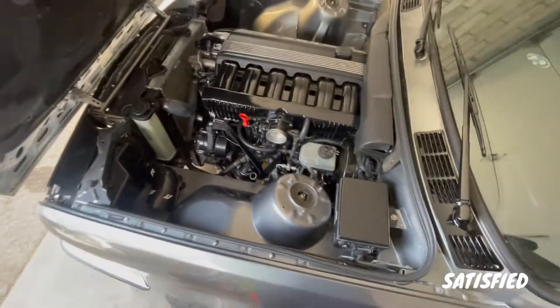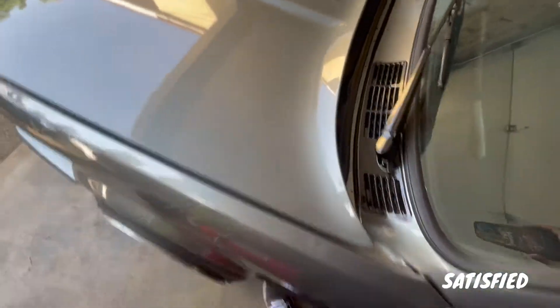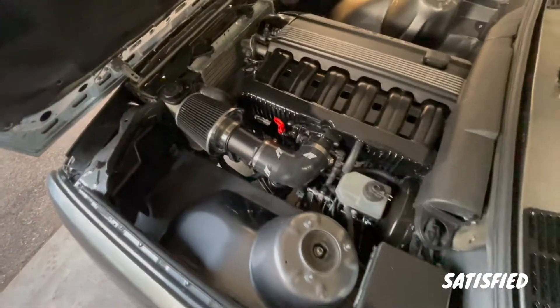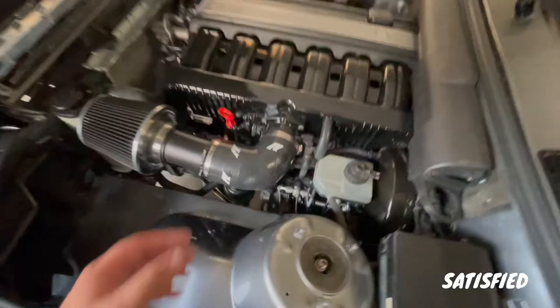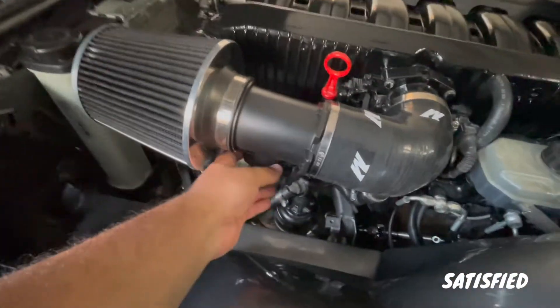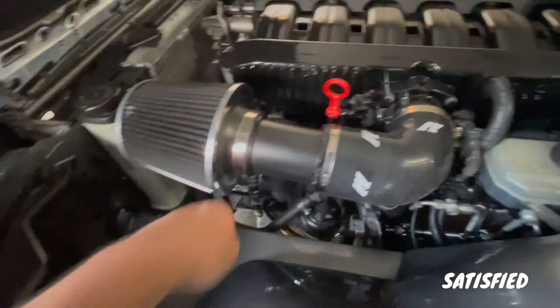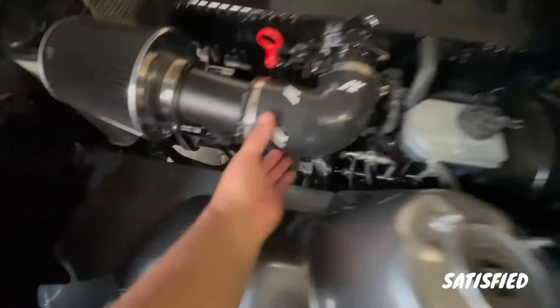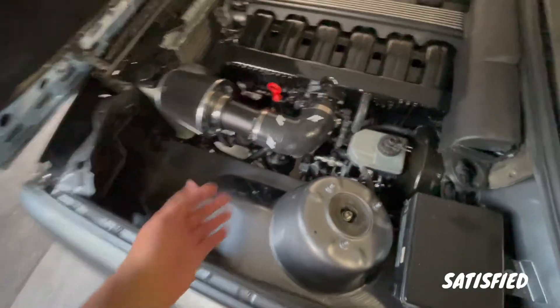Do what everybody does — close the hood, wait a couple seconds, and then magically everything just goes back into place. This fit perfectly fine. The silicone is actually so strong that I'm able to hold the MAF and the intake up. Before I had a little bracket that would hold the intake itself, but now it's able to hold it on its own and it looks way nicer than before. All right guys, I'm gonna end it here. If you guys want to see more videos, like, comment, and subscribe to my channel. I'll be posting more about the E30 build and I'll see you guys in the next video — peace.